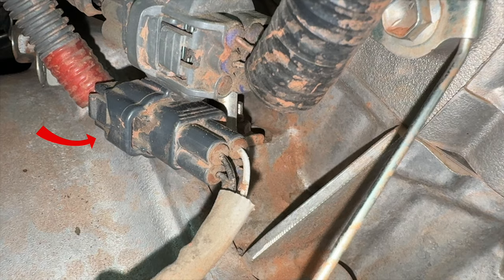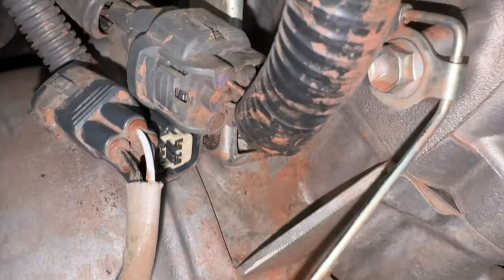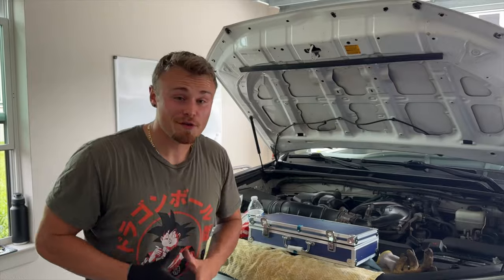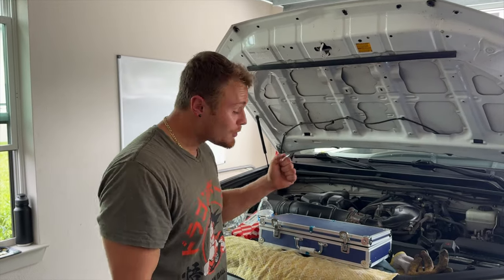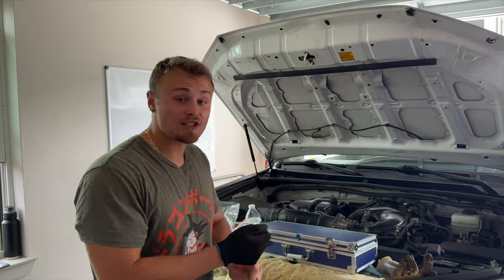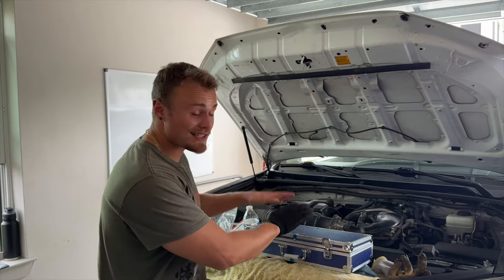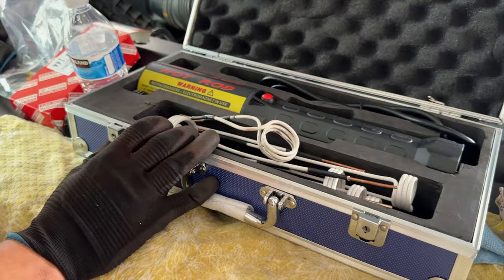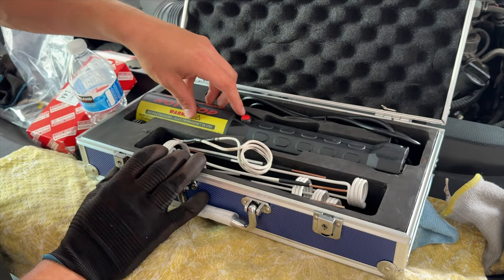It's the dark plastic clip — you push in on the side. As you can see, it's unplugged now. You'll also need to unhook the wire from around the metal holder. Now this is optional, but because I want this to go smoothly I'm using an induction heater — I'll link this down in the description. I don't want to put a torch down there; most shops will, but I'm not comfortable doing that. This is the next best thing. I got this on Amazon for about $150-$200. Anything metal heats up red hot with this pretty quickly.